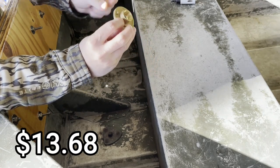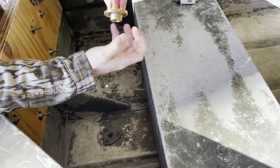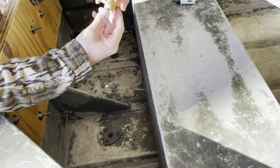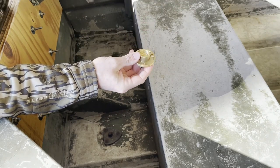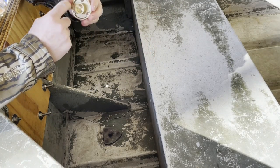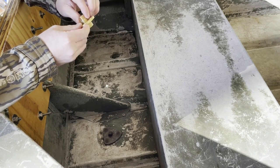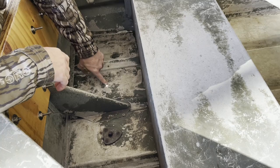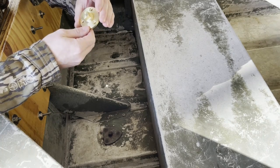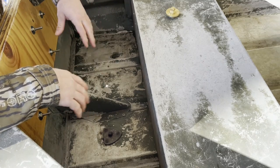It's a little two-piece, a little bit thicker than I really wanted depth-wise. I'm going to try to find a little vent to go on the bottom of it, kind of like this one, to protect it. What I'm going to do is drill a hole with a hole saw — this is about the exact size of it — and use silicone all the way around it and on the bolts. What I'd like to do today is drill out the hole for this, get it siliconed in place, and probably drill out the holes for these and mount it good, so I can go ahead and start sealing all these rivets on the inside and start laying paint down on this thing.